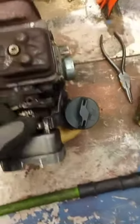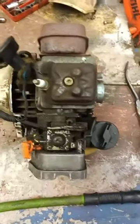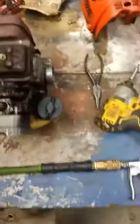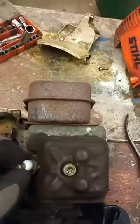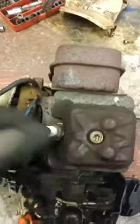I'm doing the bubble, it's gotten so old. This line trimmer still works fine. It's just I broke the string. If I let off idle, it'll die, but man, it's got good torque and everything. So when I was taking the cover off, I got everything off except for this rubber piece, and I've never done the spark plug. So I pulled it, and when I pulled it, I pulled out the metal thing there. The metal thing remained on top of the spark plug, and I had to take pliers to get that thing off the end of the spark plug.